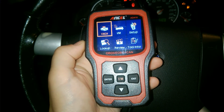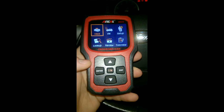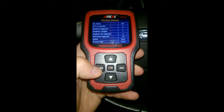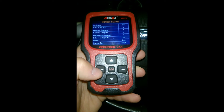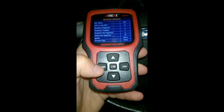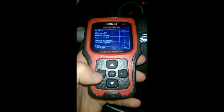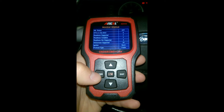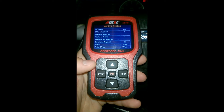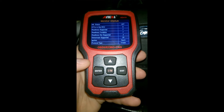One of the first things to check in the OBD2 menu is a table of indicators. The first is MIL status — malfunction indicator light status — which is the light that appears on the dash when the car detects a problem. In my case it's off. Then you have diagnostic trouble codes, or DTCs, which I have zero.